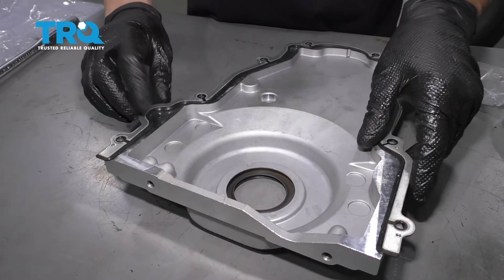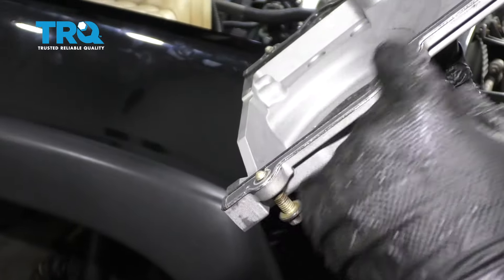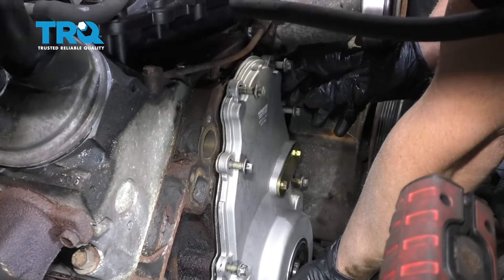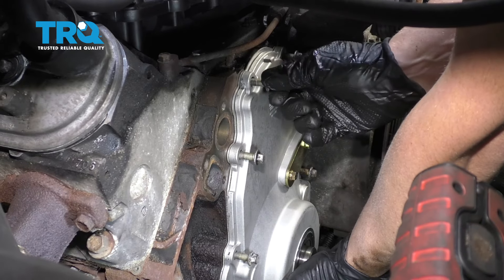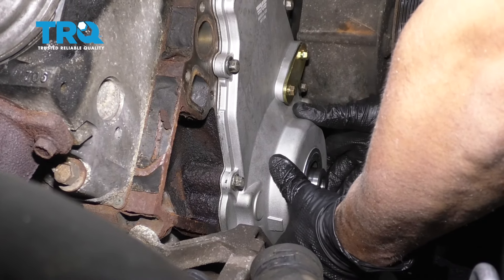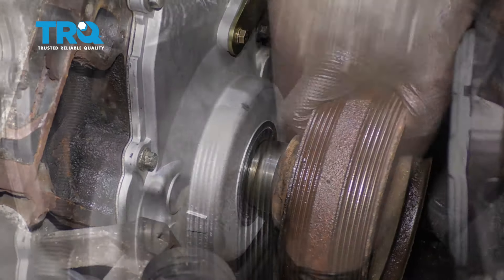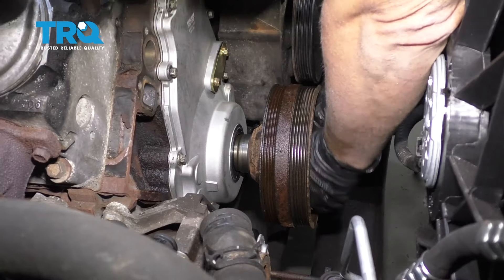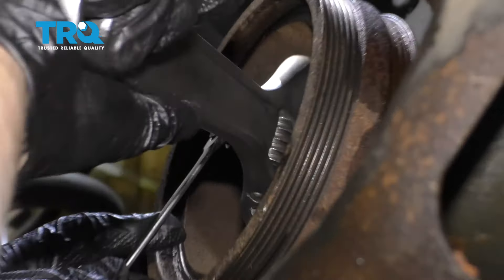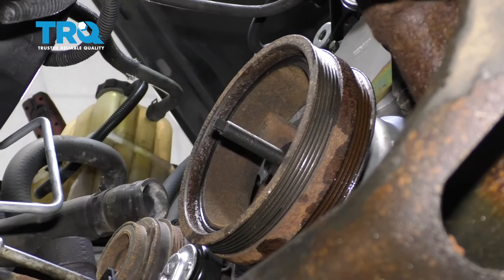Take the gasket and line it up — it only goes on one way. There is a little bump on this side over here. Take the bolts and slide them through the cover. The gasket should hold the bolts in just like this. Line the cover up and get the bolts started. You don't want to tighten these down too much — just loose enough so that I can move the cover. Now there's a special tool that GM uses to line this cover. We don't have that tool, so we're just gonna install the harmonic balancer and do the best we can. Now install the harmonic balancer and use this harmonic balancer installer — that's gonna slide the balancer onto the crankshaft. It's easier to install this from underneath the vehicle. I just have to tighten the nut down. Now the balancer's all the way down so I can loosen up the tool and take it off.